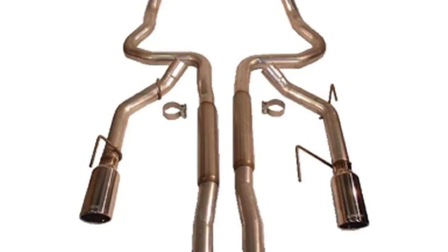Number two is a full exhaust system. A cat-back exhaust is really all you need to lose some weight and, of course, make your car sound a lot better. Going to aftermarket cat-back can cut out anywhere from about 20 to 35 pounds just by switching out your mufflers and eliminating that resonator. I think that's really all most people will need, and that's where I would land for a budget build.